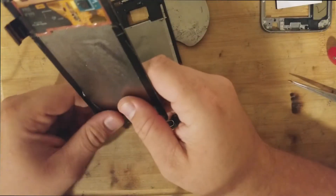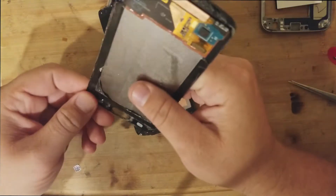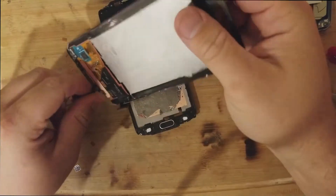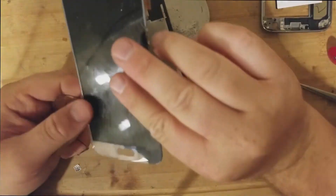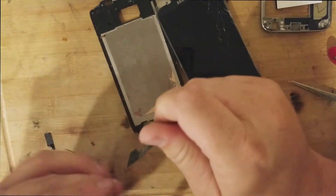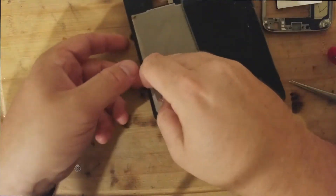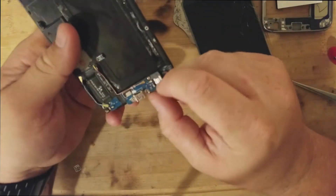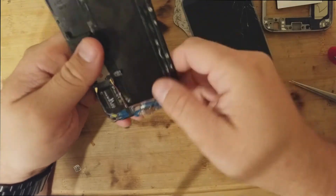So you're going to take this display and ship that to me and you get a credit for a good one, or we can always send you back a refurbished one — either one you want to do. So when pulling off these displays to change the charge port, that can be a problem because this paint can come up. Watch out for that and make sure you tell your customers. If you want to change the charge port, you literally just rip these pieces off, take off that screw, replace the charge port, and make sure you transfer the antennas — it's pretty straightforward from here.